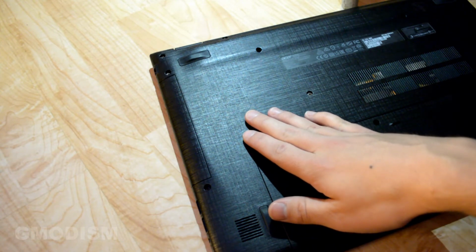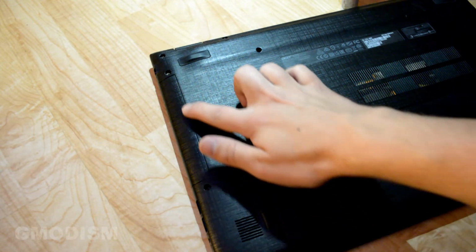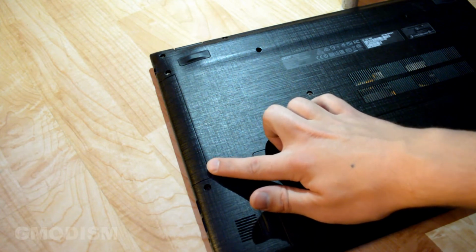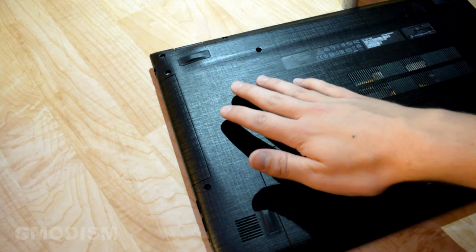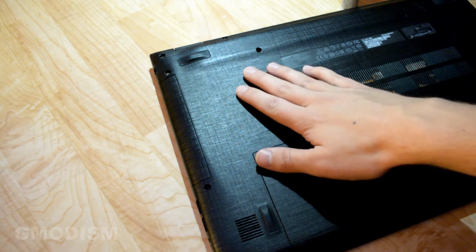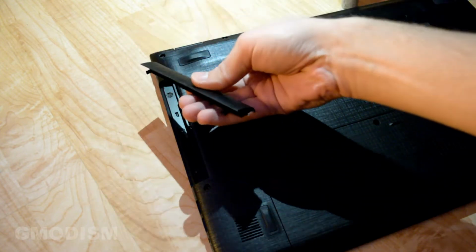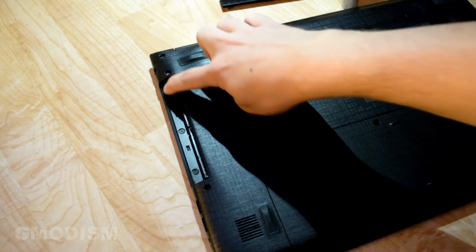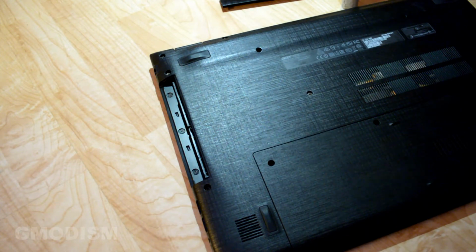And to utilize an HDD Caddy, you don't actually need a disc player, you just need the space for one. My computer doesn't have a DVD or Blu-ray drive, it only has empty space, but it has the expansion capability, which is the only thing that matters. Here you can see this little lid. You can remove it and see the area where your disc player goes. If you actually have a disc player here, it's much more defined and easy to understand.